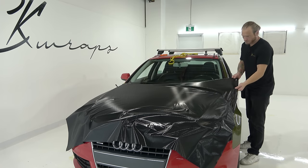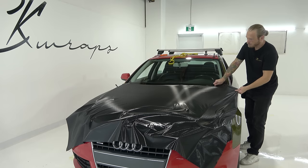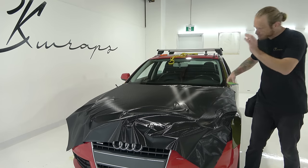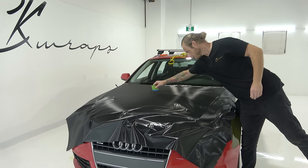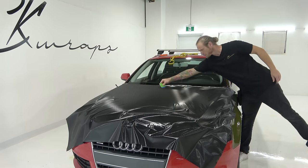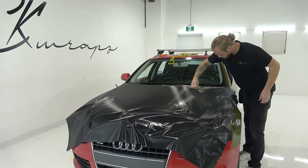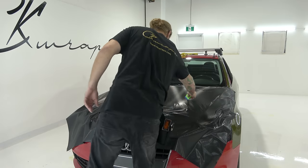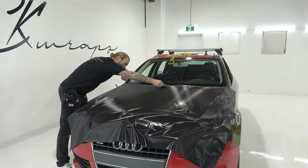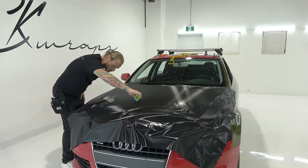You can see that we have an area that's much easier to squeegee and work with right now. So I'm going to fix this up right here and then we're going to start squeegeeing out some of the air. Let's lift this corner up — I'm not certain the threshold of this film yet, so I'm just trying to be careful. Carbon dry carbon fiber generally is a more fragile film because the film has a pattern to it. If you get a small tear or a small run, the film will tear all the way — it'll just shatter, crack, or break right down that line. Firm squeegee pressure is very important here — we want to make sure we squeegee out all of the air. Make sure you're being thorough and overlapping your passes — that's super critical.